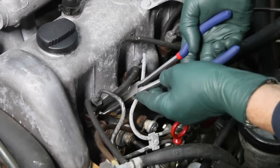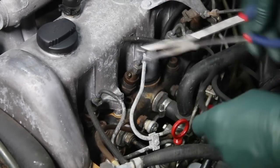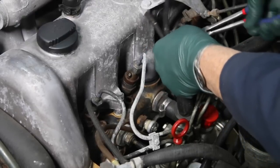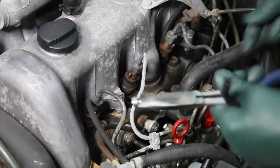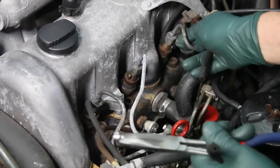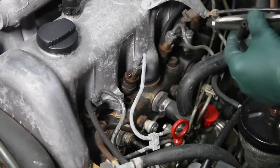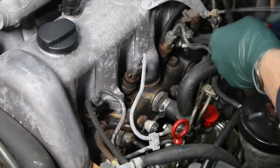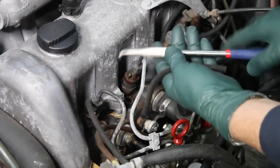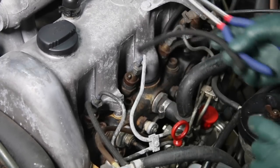I can use this at different angles and get right in on these other hoses and just start pulling them off like this. And then what's really nice — I'm sure some of you have tried to put these back on and you know what it's like trying to reach down in here. You reach in and you shove on it and it twists and bends. Well, watch this. You put this right there, about three-eighths of an inch so you can clear the nipple, and then you just come right down in here and move it back and just push it on like that. Isn't that slick? It makes replacing these injector return hoses actually a pleasure.